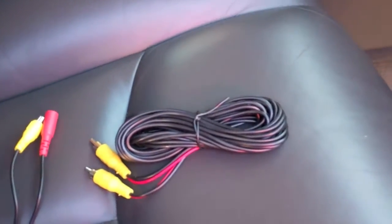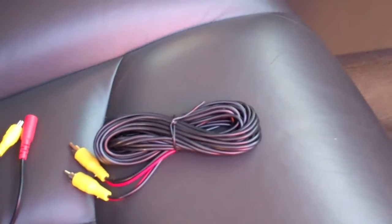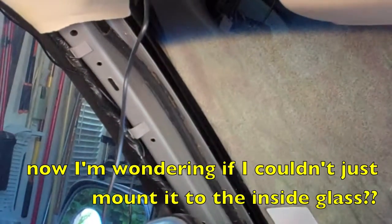The other thing I thought about when I was talking earlier about doing the GPS antenna to the outside, and I thought, well, I'll just temporarily wire it up. Problem I thought of immediately is I pulled that trim piece off, and so if I drop the wire down into the back of the stereo and just have the antenna side loose, I may not be able to fit that through something. So I'm probably going to go ahead and pull down the headliner here and try to start from the outside of the vehicle and fish the small side of the antenna through. I'm glad I caught that before I got into this project, because I wasn't thinking about that at the time, and obviously hopefully it saved you that trouble too.